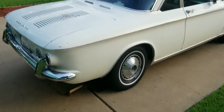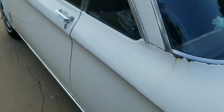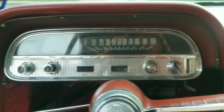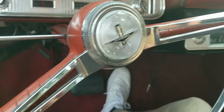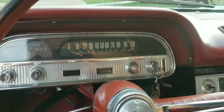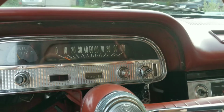Okay, so back from work, I was not able to get that little fill plug out on the transmission. I tried to use an 18 and a 17, I believe. 17 was too small, 18 was slipping. But on my drive from home, maybe 10 minutes of driving, there was no smoke out of the exhaust. Not sure about in the morning when I drove to work, because it was a little bit dark, so I couldn't see if there was any smoke.